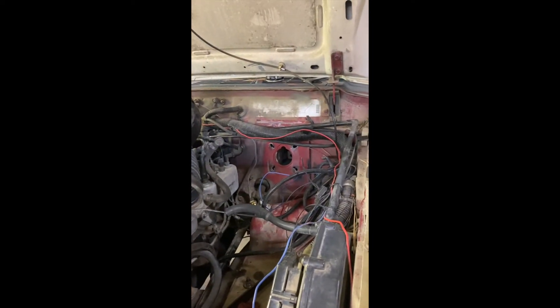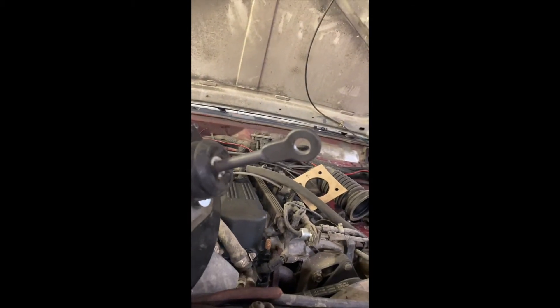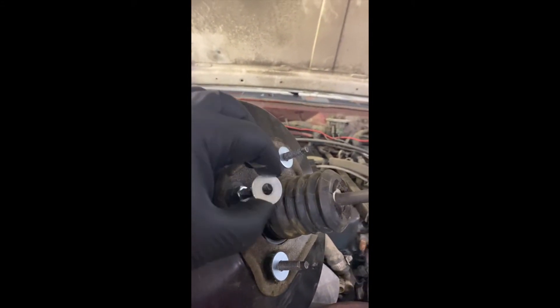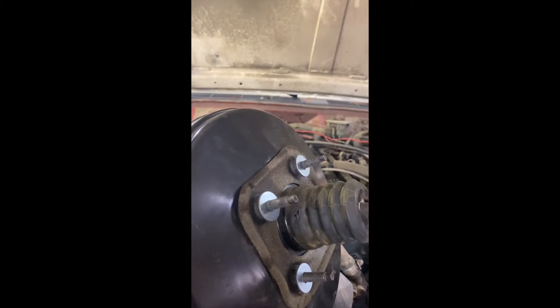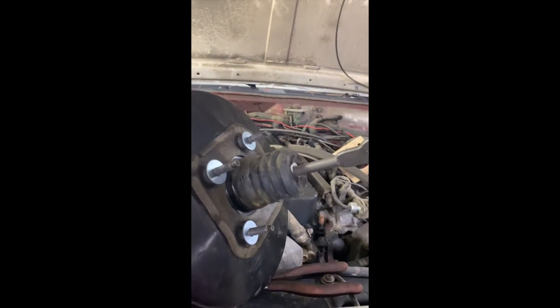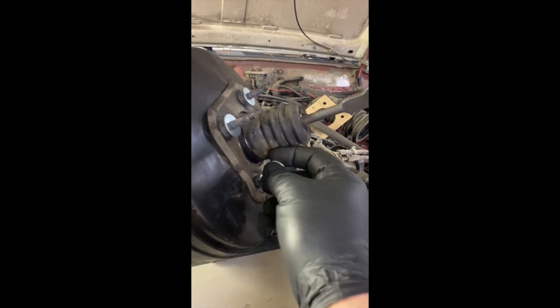On the inside, it looks like it's going to fit with the pedal and we should be pretty straightforward on that one. This eyelet here has to be opened up to a full half inch to match the original 92. We've drilled the holes in our firewall. What I've done is gone and got M8 by 1.25 nuts. Because these studs are a lot longer than the other ones, I'm going to space it off, give it a little washer to help cover up some of the gapping and the holes we had to drill. That should put us where we need to be. Another reason to put the nut under the washer is because if I need to pitch this up or down, I can adjust the nuts in or out to get the angle that we need.